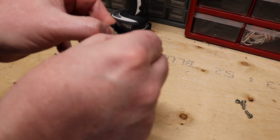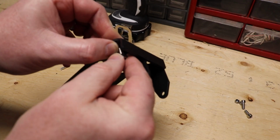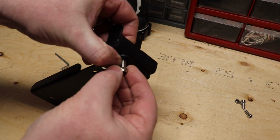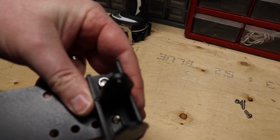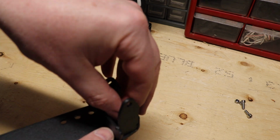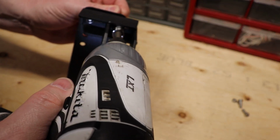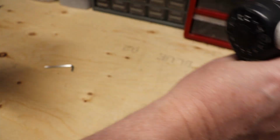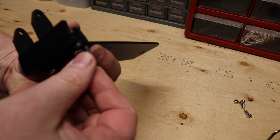All right, so you get the bolt, put that inside this way, because you want it flush on the back side. If I had it like that, it's gonna stick way too far out into the actual chassis of the Jeep, and there's not too much room back there. So let's just change these bolts so they're going beside that. There we go. I'll drop the nut on top of that and get the Allen key on the back here. Okay, we want to have this as far over as possible, to make life easier on us inside the cab. So again, Allen key on.